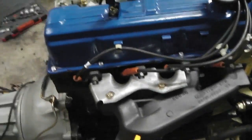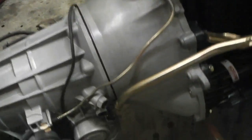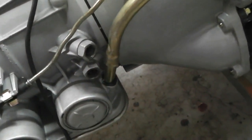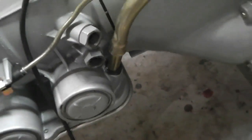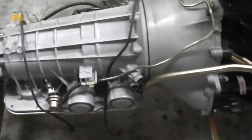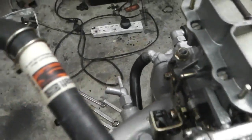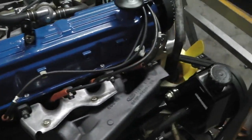Right, what do we need to get this going? Well, as I said, you've got your pressure pipes. So that's going to circulate oil around the pipes to the radiator to cool it down. You could just put a loop and a turn on, but I want to run it through the rad. The whole point of this is to test things. We've got a vac pipe there, which is a bit too short and needs to get to that vac point. We need to blank that vac for the servo off. We need a coil.